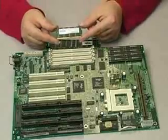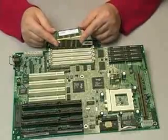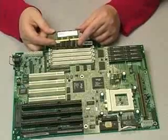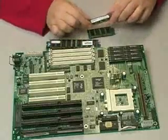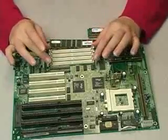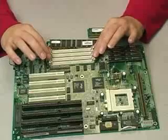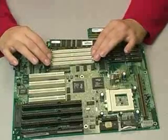These are examples of memory modules that go into a laptop — much, much smaller. Our next demo will be the inside of a laptop and what memory goes in it. There's also a label here from Crucial.com. They have a free memory scanner that will tell you exactly what's inside your machine and all the different possible combinations of memory you can put in, including the maximum amount your board supports. Some machines can't take more than one or two gigs; some newer machines max out at four gig. It'll also tell you how many bays you have, if any bays are empty, and how to install the memory. Some PCs work better with paired memory — two of the exact same modules side-by-side — for optimal performance.